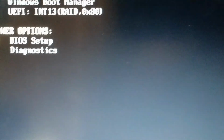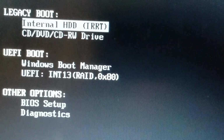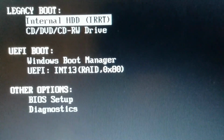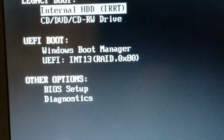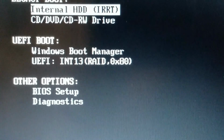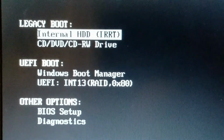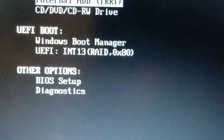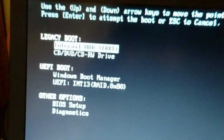All right, so changing the power options in Windows did not fix the issue. I did a little more reading, and it seems as though it may actually be caused by setting this machine up to run with UEFI instead of the legacy default settings the way it was, because I went into the BIOS and changed it to UEFI to install it, and I think that might have been the issue. I can also check here to see what the BIOS revision number is.